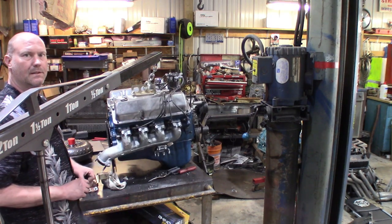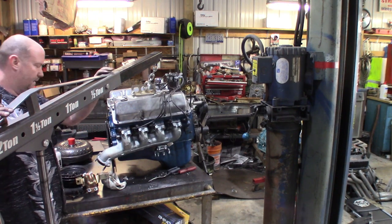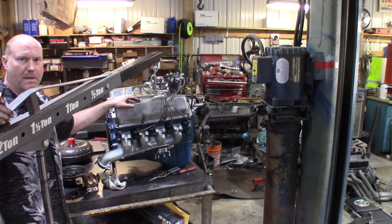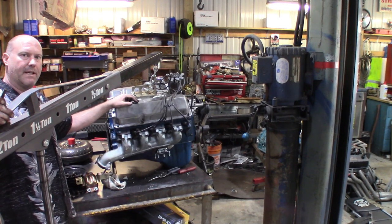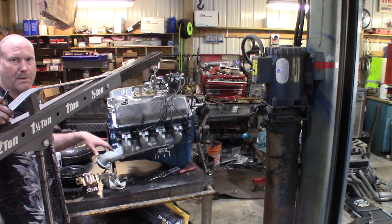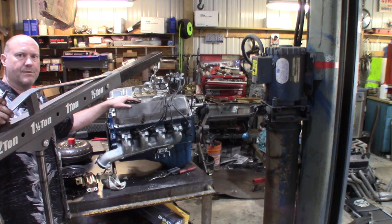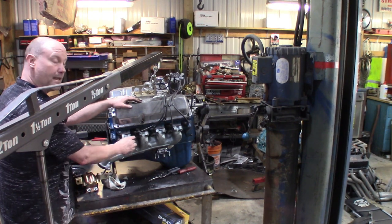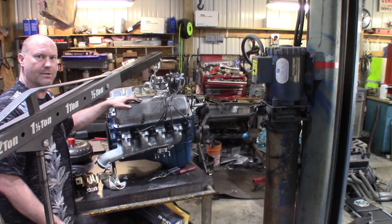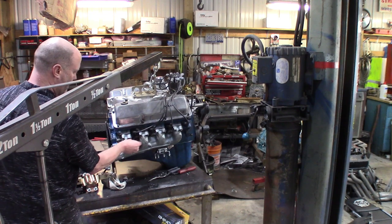And again, I know, as I'm speaking to you over my engine lift, I feel like Wilson out of Home Improvement. But again, you don't have to pull the engine to change exhaust manifold gaskets. With the engine mount that was melted, all the wiring I wanted to clean up and everything else, I felt it was a lot easier to just pull the engine out, change these exhaust manifold gaskets on the bench, and make those templates for the heat shield for the engine mounts. I also want to open up the valve covers and relash all the valves and clean up the valve covers because they're pretty nasty. So for those reasons I chose to pull the engine at the same time as doing the trans. Again, you don't have to, but it makes it a lot easier. At least it did for me.